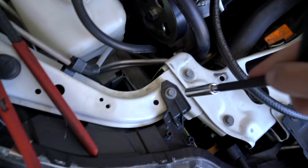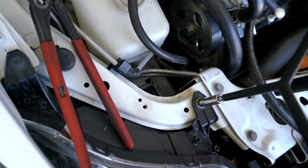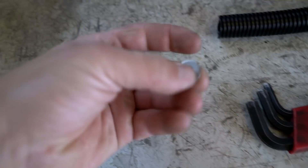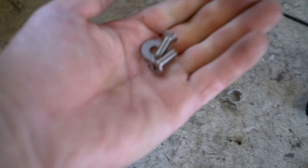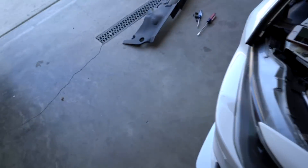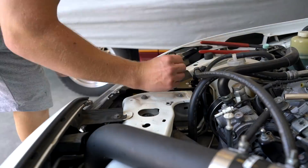Bent something like that — that should be enough clearance. Let's pull out the bolt for the headlight, just a 10-millimeter socket. We're going to have one flat washer and two Allen head screws. Let's go get this catch can bolted onto the car. All right, catch can's on the car — everything's clearing, the AC lines are clearing.